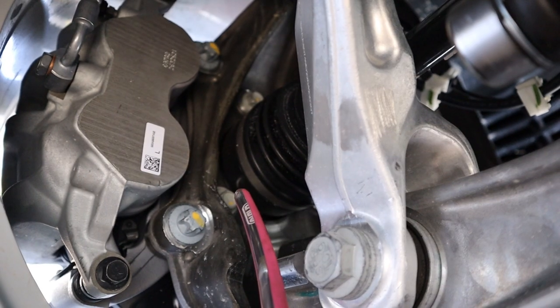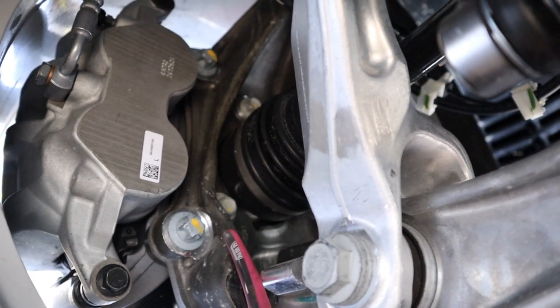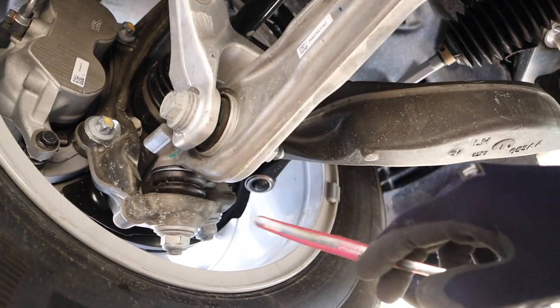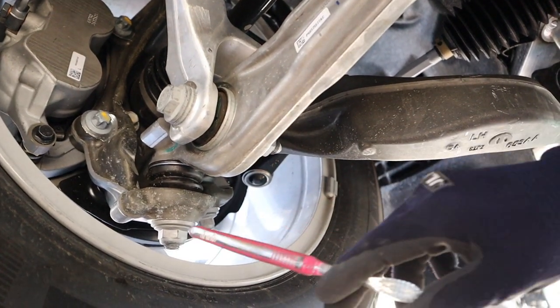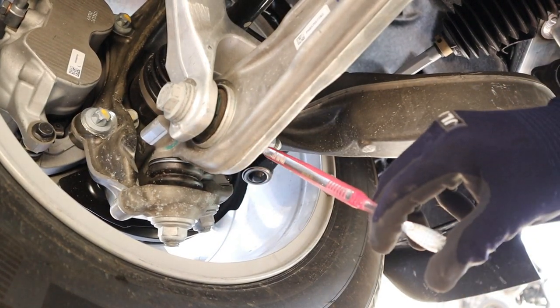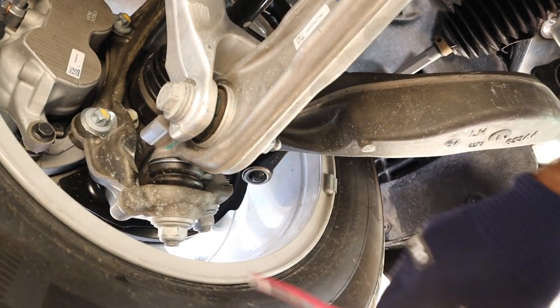These struts are only for the soccer mom model — most other Jeep Grand Cherokees are going to be equipped for off-road use with air suspension. Because this vehicle uses aluminum knuckles, changing bearings is just a bolt-on style, so you don't need a press. One thing I'm noticing in the industry is that they're moving towards disposable fasteners — they don't want you to reuse the nuts and bolts because they don't want the liability; once they've been threaded on you can't guarantee the prevailing torque.